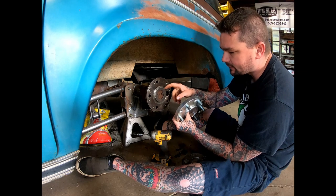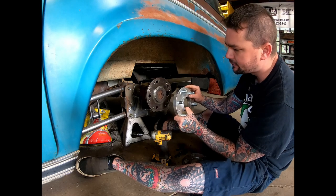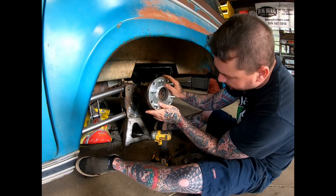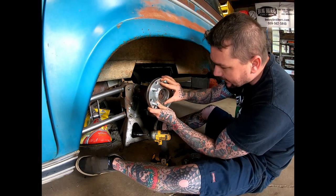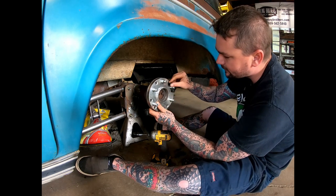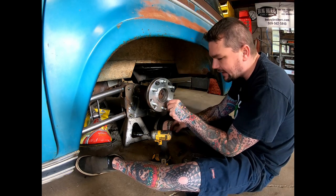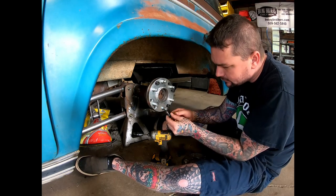When I had these axles out, I welded up this hub. I took it to my buddy's house who has a lathe, and we turned it down so that this outside adapter, which is 3/4 of an inch thick, will pop right on here. So it's hub centric to it and locates it. I then brought it here and drilled and tapped the axle itself, so these bolts lock this to that. The bolt will come out the back side about 1/2 inch, which should give me room to put the lock nut back there as well.